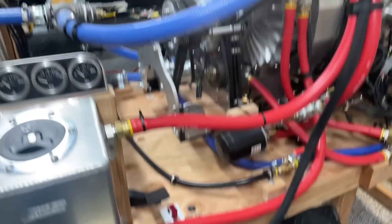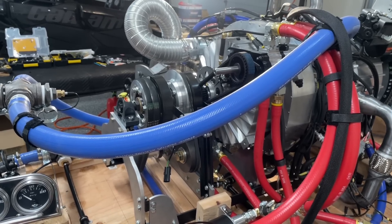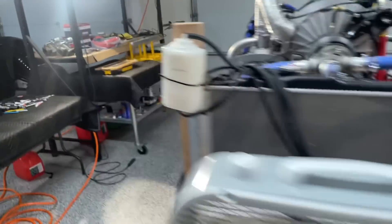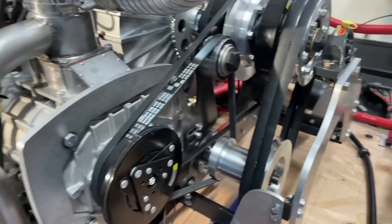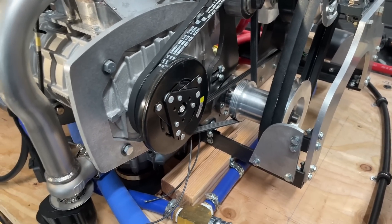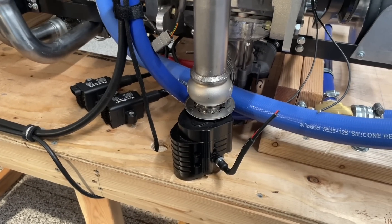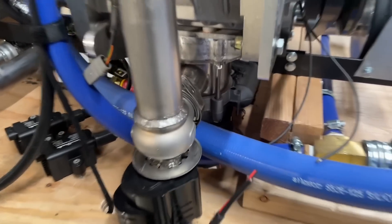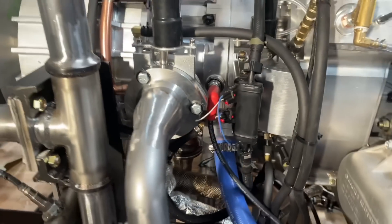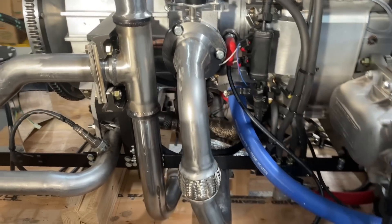We've got an ECU here in kind of a dyno harness, and it's got a supercharger on it, which it will ultimately have turbos also, but for right now it's got a supercharger on it. They've developed this two-speed control method with just using clutches and pulleys, so they can turn this clutch on and get one blower overdrive, and turn this clutch on and get a different blower overdrive. We're using one of Marty's wastegate valves here as a turbo bypass. You can see the throttle down there — the drive-by-wire motor. Right now we don't have the direct injection active; we could just run on port injectors, which simplifies it some, but you can see that it's quite complex.